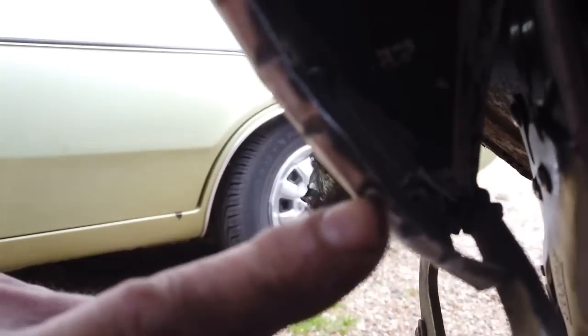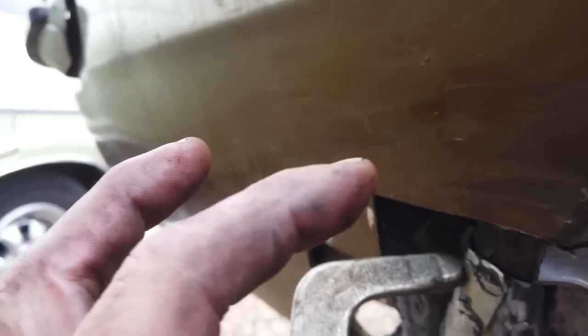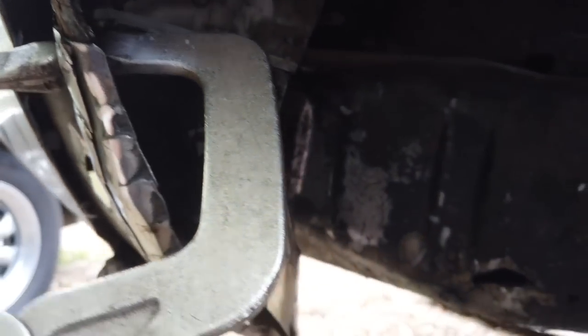And there's a weld line goes on it, and dress the weld up. There's some serrations here, but I've welded the serrations back together, then hammered it into a curved shape. What you get is the lower section of the wheel tub recreated.